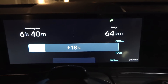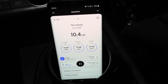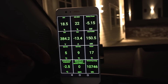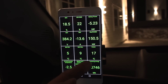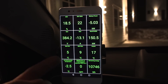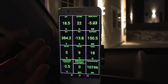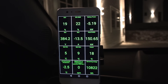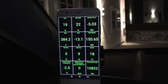We're pulling 10.5 kilowatt from the charger. The easy app shows 10.4 kilowatt, three phase, 15.6 amps. So we're pulling 10 kilowatt from the plug, but we're only inputting 5 kilowatt into the battery — the remaining goes into the battery heater. It just says 'heater' but it's the battery heater. The battery is so cold it needs to heat up just to charge, and roughly half the power goes into heating the battery.